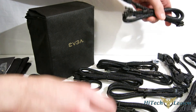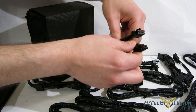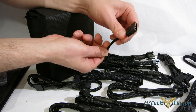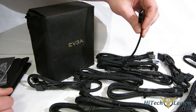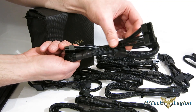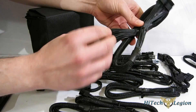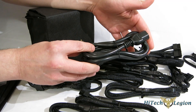Taking a look at the VGA cables — same push-together design, 6-pin to 8-pin. The floppy adapter is just a small attachment that goes into a Molex, so you can plug in a floppy if needed; most people don't use them so it's nice to have it out of the way. The motherboard cable is nice, thick, and very well done — individual cables going into the black sleeving. Finally, a nice 16-gauge heavy-duty power cable is included as well.